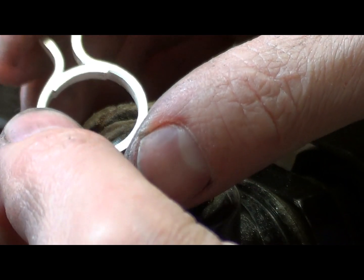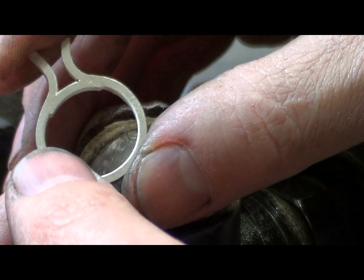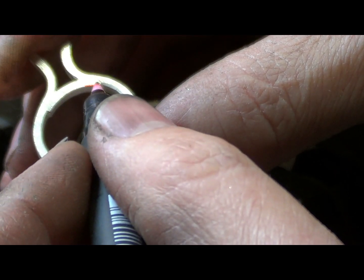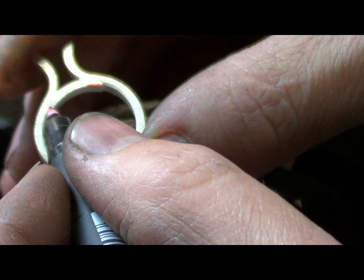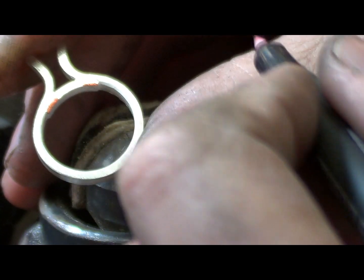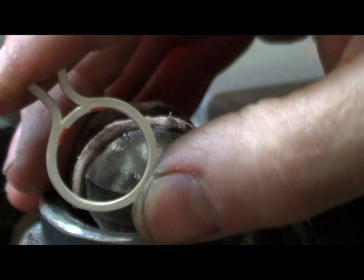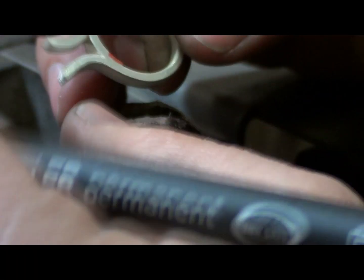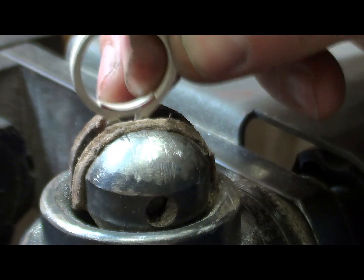The ring shank on the inside still has a bit of an issue. It's got these shoulders where the undercarriage stuck out just a touch, which we need to file off with a half-round file. We need to be careful because you can destroy the undercarriage and therefore the whole ring at this stage. We're going to do a bit and then check it — do a bit, check.